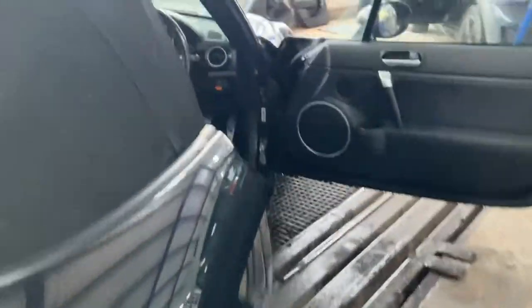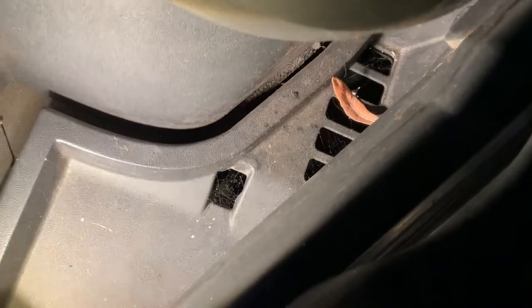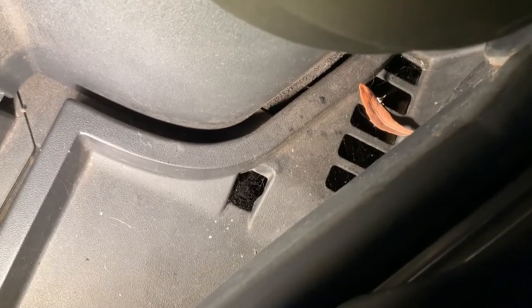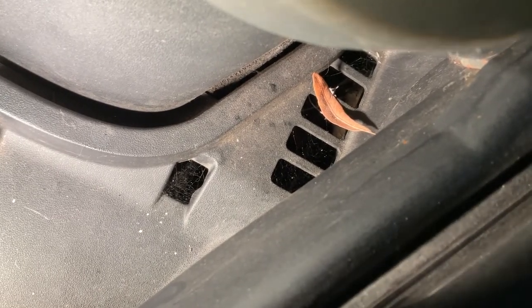If we quickly open the roof up so we can see what we're doing — let's grab our torch. Another common problem. We can see that the rear drainage system is blocked in there. We've got water obviously staying in the actual drain itself. If I just rock the car — we can see water in the bottom there. It's quite hard to see because it's got a casing around it, but it's not draining away the way it should.